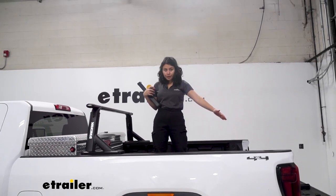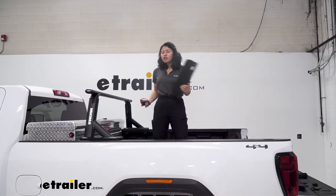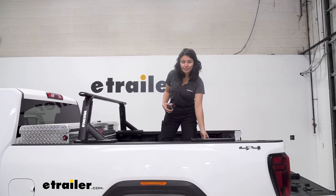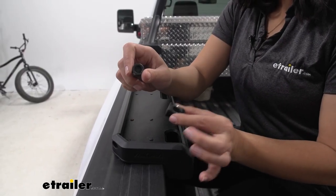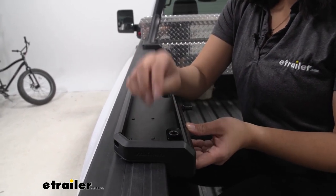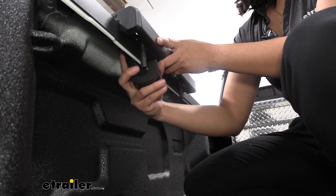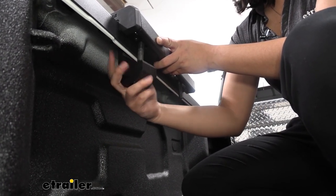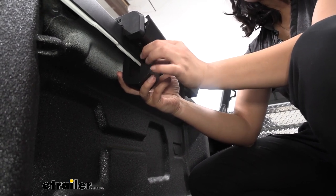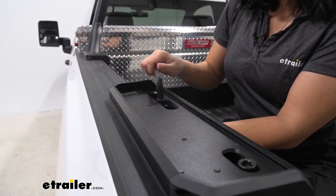Plan out on your truck bed where you want to put the towers. I have an eight-foot truck bed here, so we've got plenty of space to work with, but we also have the toolbox, so you need at least 36 inches of distance — we're going to put it at about the four-foot mark. The base sits flush against your truck bed sides. You then drop the rectangular plate and bolt in through from the top, then get your J-shaped bracket to go underneath your truck bed. Feel around for obstructions, line it up with the bolts holding your base together, and hand-tighten them for now. Then use the large hex tool included with your kit to tighten down these larger bolts.